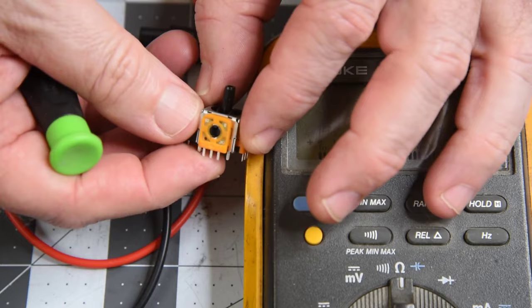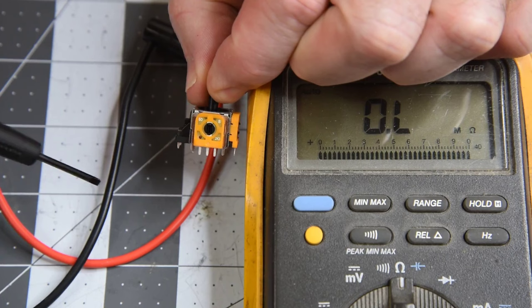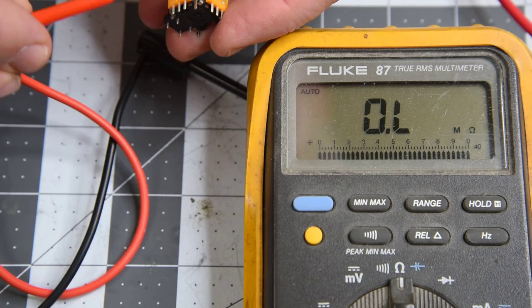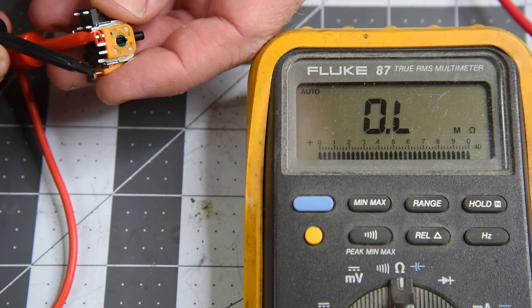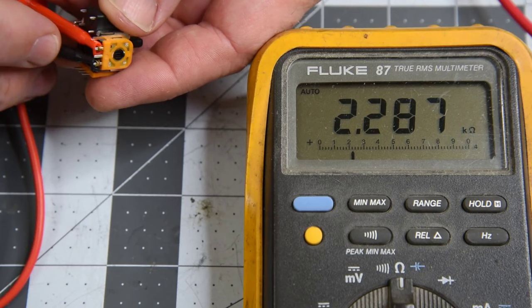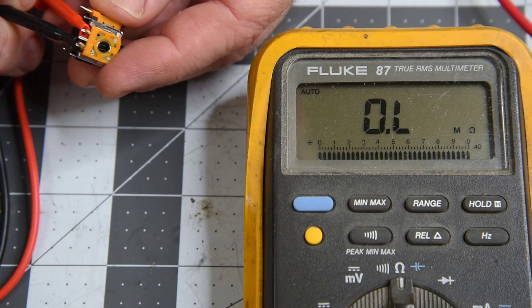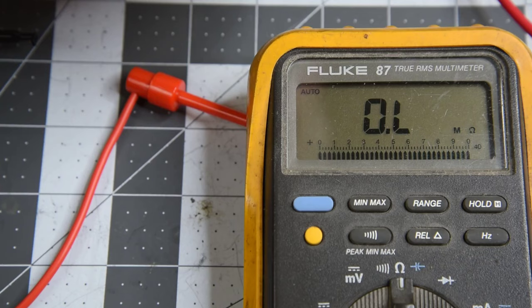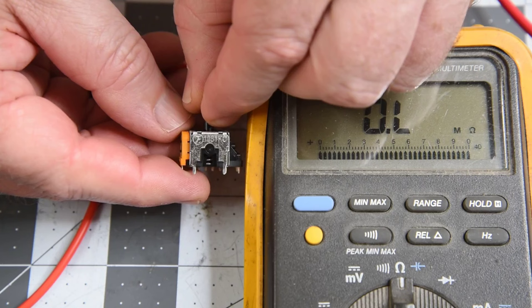As for getting the right replacement parts: the first PS5 joystick replacements I ordered came from Amazon. The ad didn't give the value of the potentiometers, just that they were for the PS5 DualSense controllers — they were not. They had 10k pots on them; in fact they were Alps brand, the same I'd used in PS4 controllers. So I ended up ordering the joysticks from a place in Hong Kong — kasyNparts.com. With cheap shipping it took a month to get the parts, but at a little over a dollar per joystick I think it was worth the wait. They look like the OEM Favor Union parts with 2K3 on the pots — just what I was looking for.